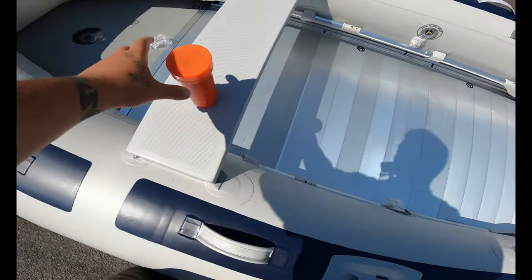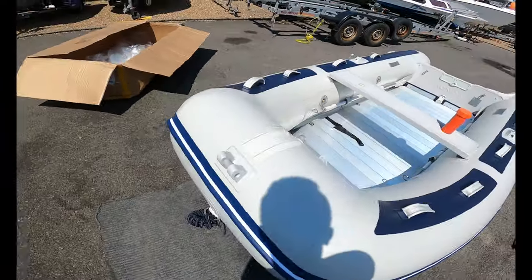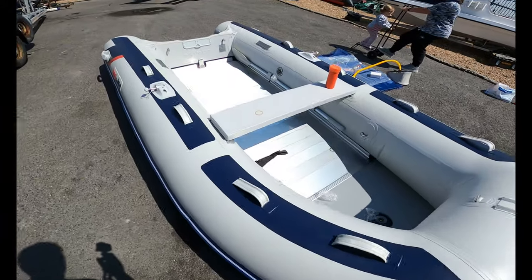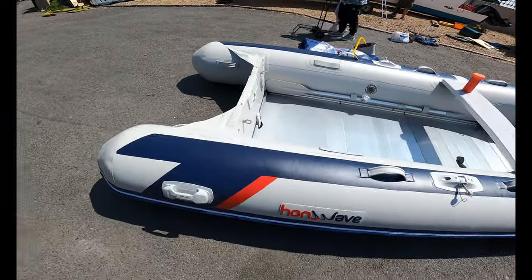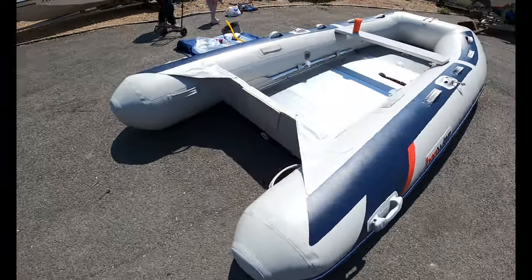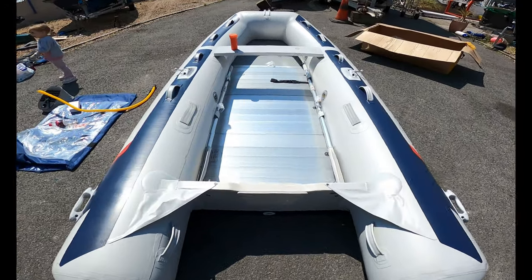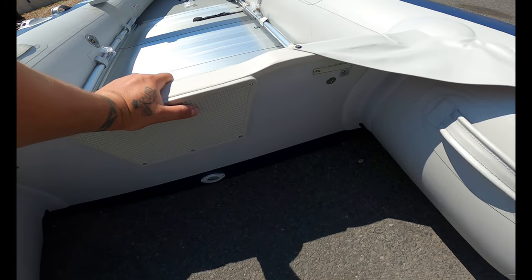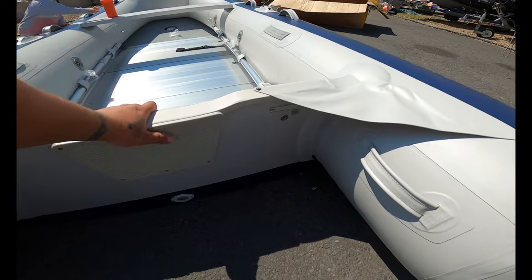No, guys, well happy with it. It's got the inflatable keel. You're going to punch through the water nicely. I'm going to be putting a 15 horsepower Johnson on the back of this. It's going to power it perfectly. You can take up to a 20, but I don't really see the point in upgrading for an extra 5 horses. I am going to be drilling into this transom to put my launch wheels on for my first day out on it, which will be tomorrow.